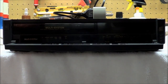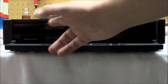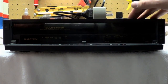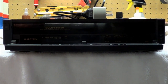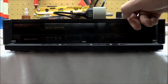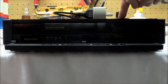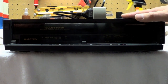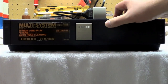Let's open it up a little bit. In the flap we've got everything you'd expect: power, eject, rewind, play, fast-forward, record — the whole deal. Now the quirky part: with this unit you have to know what you're putting in next — is it going to be a PAL tape or an NTSC tape? There's a bunch of switches on the front to switch between standards, and you have to set it before you put in a tape. If you don't, and you insert something it's not expecting, it'll reject the tape and power down.